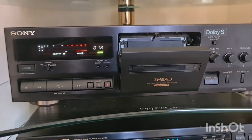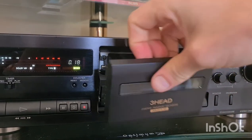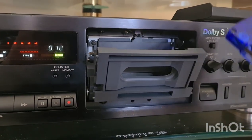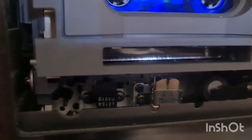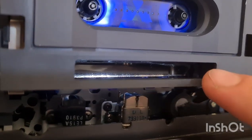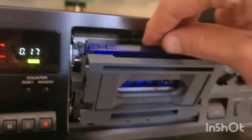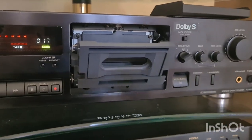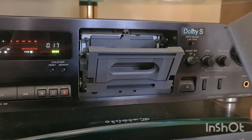So to demonstrate — this plastic cover just pops off your tape deck. Most tape decks do have a viewing area specifically for this. Pop in our tape. You can actually see the tape there, and on the right-hand side is the capstan. This is a great tool to let you see how your tape is sitting on your heads and diagnose any problems with playback. What this pointed out was that as soon as the tape started playing, within half a second the roller was skewing the tape off towards me, which meant that the treble edge of the tape was being pulled over slightly — not aligned on the head — and therefore I was losing treble. And it was particularly bad on the other side of the tape because that was the start, so the tape was a little slacker and dragging over a little bit more.